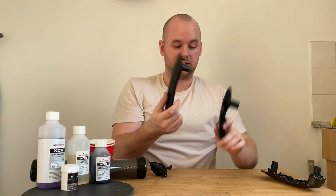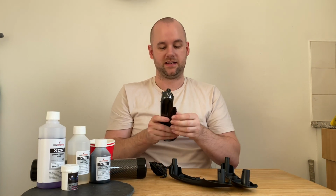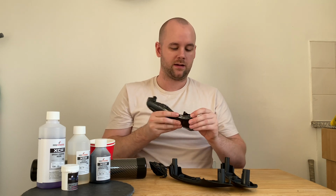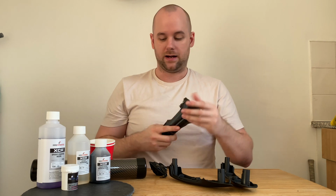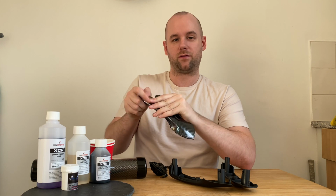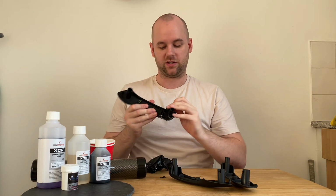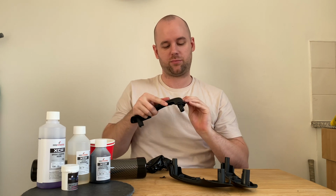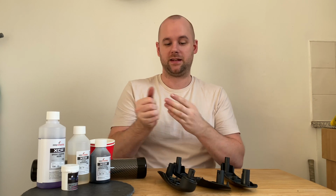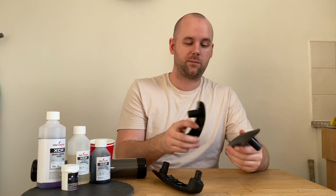So once I've sanded it, we can mix the adhesive, apply the adhesive, and then we need to wait 2 hours. Once we've waited 2 hours, we can then apply the carbon fibre material. One of the other important things is that your room needs to be the same temperature, which is 20 degrees, I believe, is the prime temperature. So I've got our thermostat set to 20, and that should keep the room at one temperature.